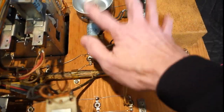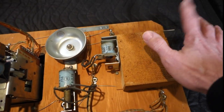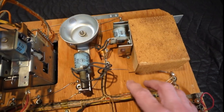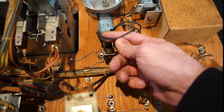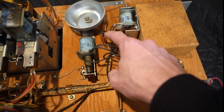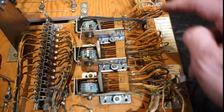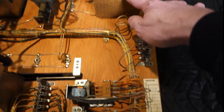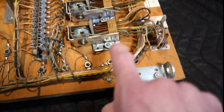We've got two sound devices here — a bell and a bar, both bells really. This one's got a black and gray wire and this one's got an orange wire. They both have a common black. Going to the 100-point relay we see orange, so that means the bar is going to be your 100-point and 10-point. Up here we see orange and gray, so it's the one point — this bell is the one-point bell.